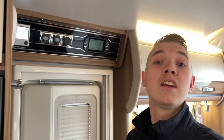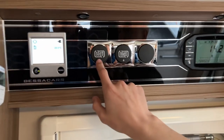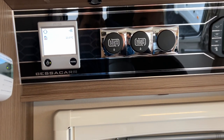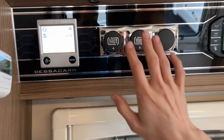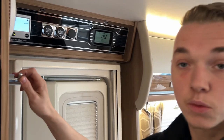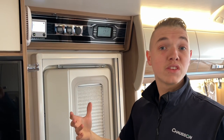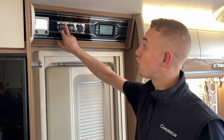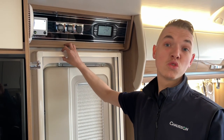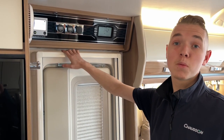As shown from outside, both fresh and waste water outlets are electronically controlled valves. To open them, press here for the waste and here for the fresh. Make sure that in the winter you've fully drained these off with no water left sitting in the vehicle, especially the outside tanks as they are just plastic. If you're experiencing frost, it could split the tank by forming ice. On the way out of your site, drop the fresh and drop the waste — but keep a little bit of fresh in case you're going to the next site or want to use your toilet or have a cup of tea. The advice is to travel with a maximum of 20 litres of fresh in your main tank and top up when you get to site.